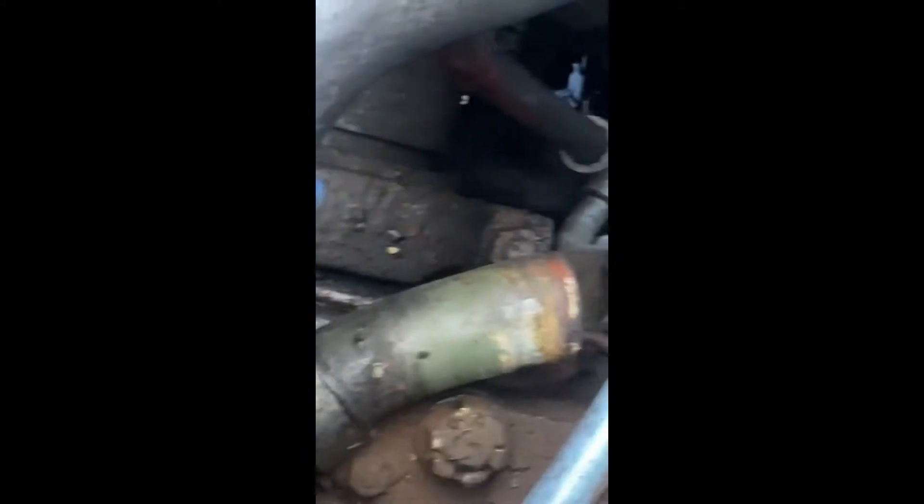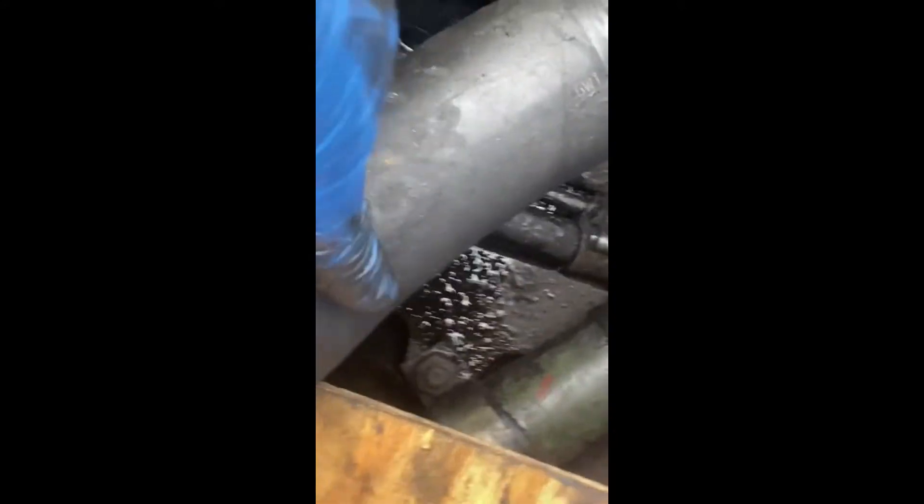Here's our hose. I'm thinking about this like an adapter — USB to micro — so you have your source, the radiator, to the main line. Before that goes back in we need better clamps on there, and I'm going to go ahead and find replacement hoses for that too, this larger size. That might be a problem — the smaller one I can get no big deal because I already replaced it on this side, but the larger one is going to be a little bit of an issue. The only challenge on this coolant hose project might be finding that larger size hose.